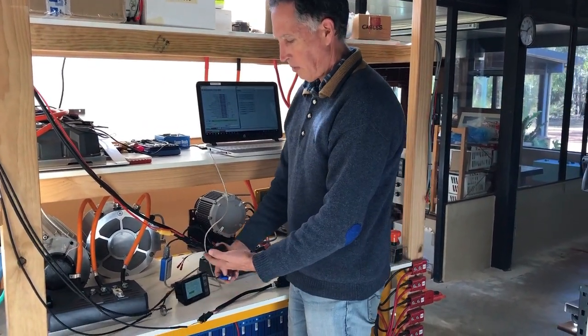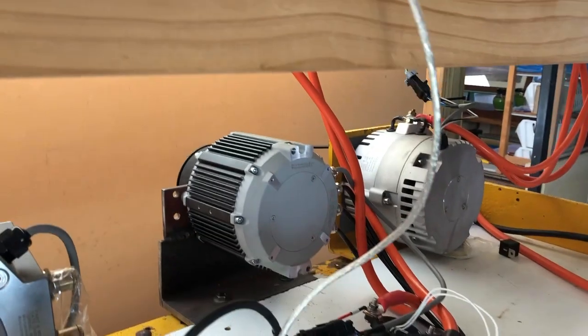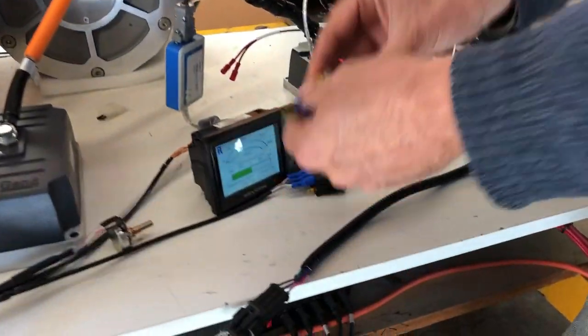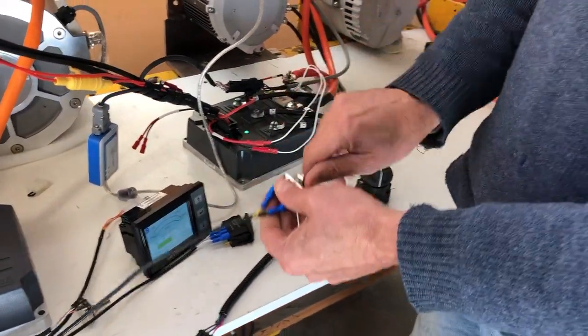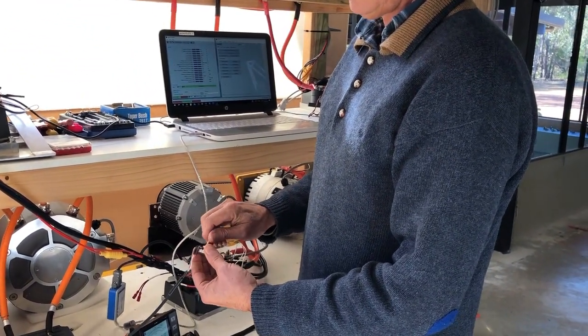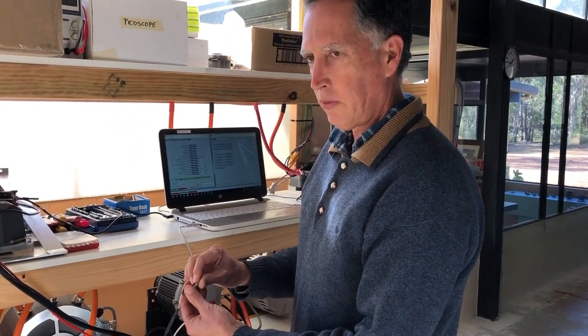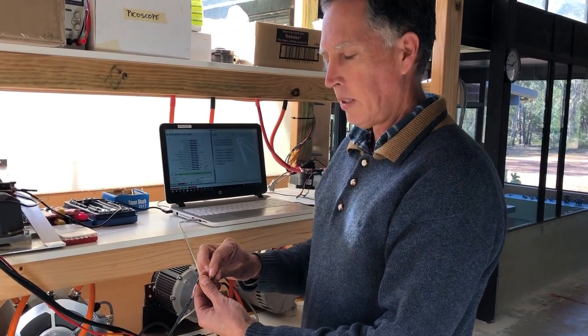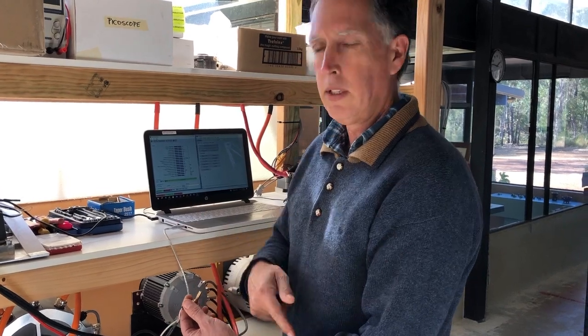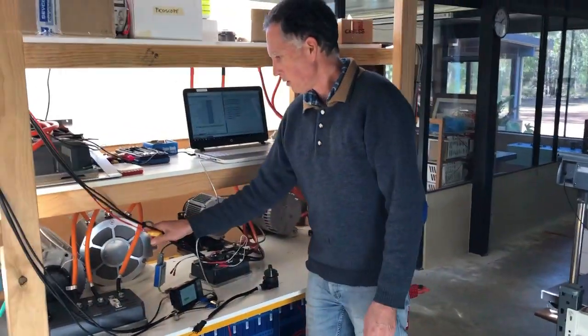As usual with all our kits, we have a forward and reverse, so we can run the thing backwards. We also have an eco mode switch — you can flick it into eco mode, which basically halves everything: halves the RPM, halves the current and power. And we've got a regen braking pot here. A lot of people ask what the potentiometer is for — it adjusts the regenerative function on the controller so that when you take your foot off the pedal, it can do engine braking, and that energy goes back into the battery pack.